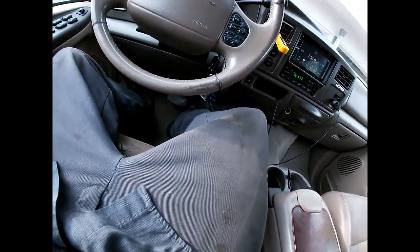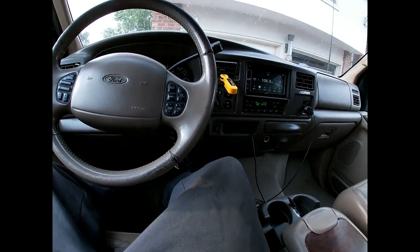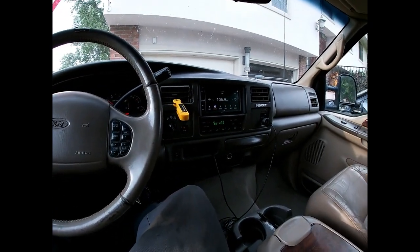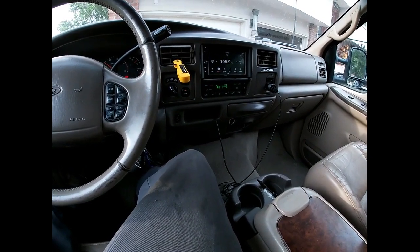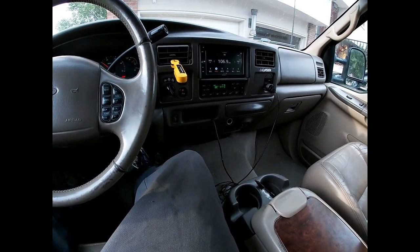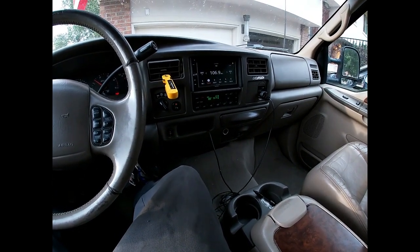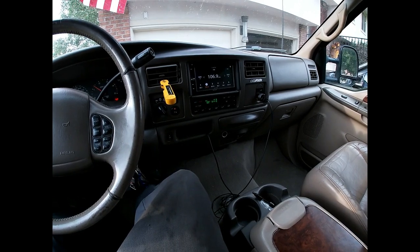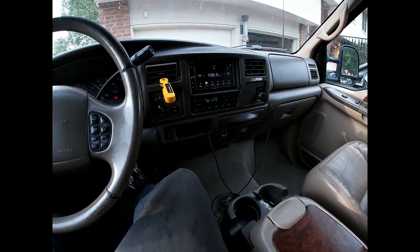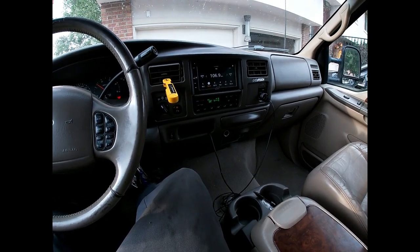Can't wait to see how it does on the highway, but that's pretty much it. The variable orifice made a huge difference — I used to swelter in drive-thrus but I don't think I'm going to anymore. If you have any AC-related questions, let me know. At some point I'm probably going to replace the compressor and accumulator on this thing and I'll document that when I do it. It's a huge upgrade — I'm really happy with the variable orifice. I'll take it to work tomorrow and go to the drive-thru at lunch and let you know how it works.